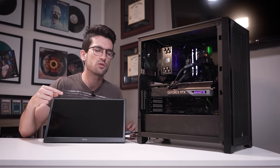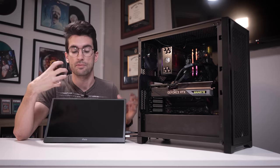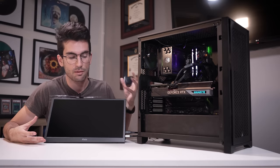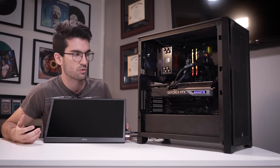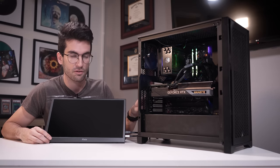But I think the first thing I'm gonna check is the CPU and then the motherboard and see if there's a compatibility or potential compatibility problem there, because that would be a very quick fix. We could just put in a 12th gen chip, flash the BIOS, update it, and then put his chip back in. Hopefully we'd have a post then. The rig is mostly new, so if it's something else, say it's the graphics card, we could very easily RMA that, not a big deal.